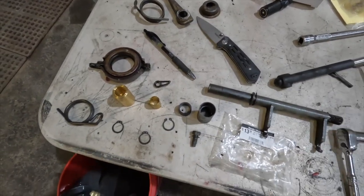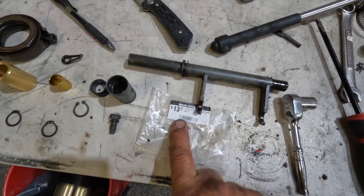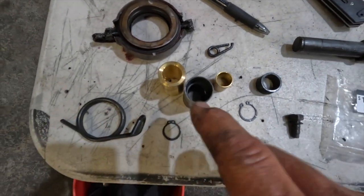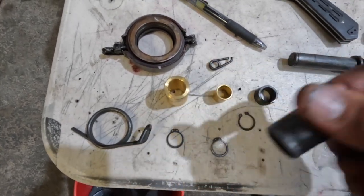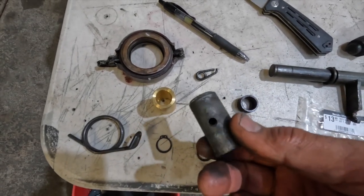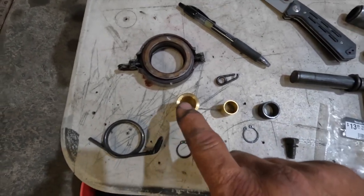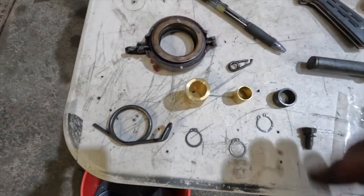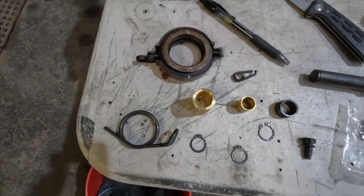Here are some of the old and new parts together - and this is what blows me away, this whole kit's only $13.99, we're not breaking the bank. But look at the difference - this is an aluminum shell with plastic bushings on the inside. This is a stock one, so it's acceptable, but I find these on Kennedy pressure plates and that's a reason why they have trouble engaging gears - it's giving up the ghost. This is the way to go: you get that nice thick bronze bushing and once it's in there it's going to last 20 to 30 years.